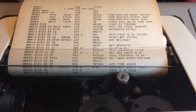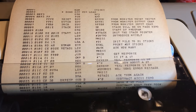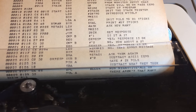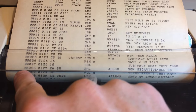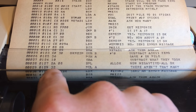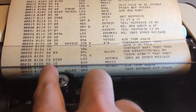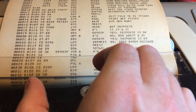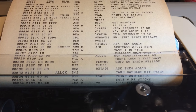So we're in the middle of printing out the program listing here. I thought it would be interesting for you guys who don't know a lot about teletypes to hear the margin warning bell happen every time that it gets about right here. This is the line number from the source code, this is the memory address, and this is what the mnemonic and any operand that goes with it assemble into in machine code. And if you remember from the source, everything was scrunched together to save space and memory. Now it is doing all the formatting to make this nicely readable.